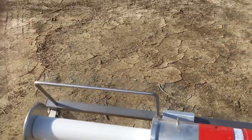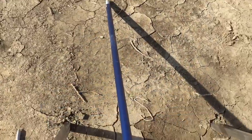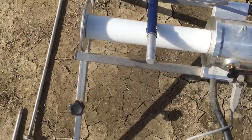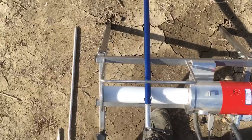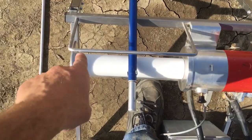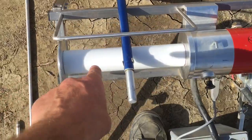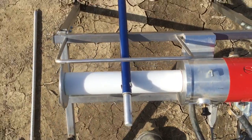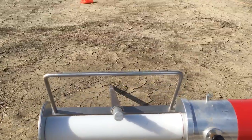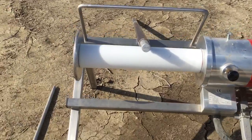Another visual: you could put a pole like this. Get it at 90 degrees — that might not look like it with the video camera but it is when I look straight down. We are not looking at the safety bar or the frame of the winch. We are only looking at the drum and our pole. Get it at 90 degrees, then come back, look at your pole, and check if it's pointing directly at the turnaround. If it is, your winch is aligned.